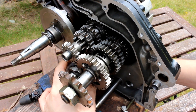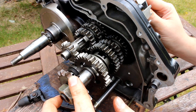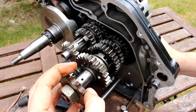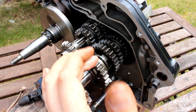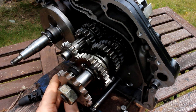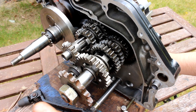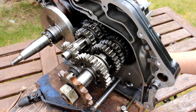That's basically how each gear works — it just depends on which gear is interconnected with which gear, and the size of those gears gives you the different gear ratios. If I do the same test as before — top tooth, one full rotation on the input — it's done one full rotation on the output too. So now we're getting much more speed out of the output: this is equivalent to fifth gear. You could think of it like a derailleur on a push bike: these are your front sprockets, these are your back sprockets — you're just choosing one front and one back. They're directly connected rather than having a chain, but it works on the same system.